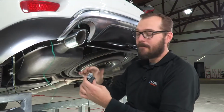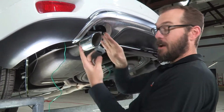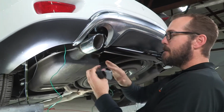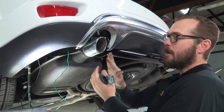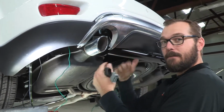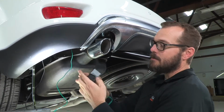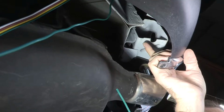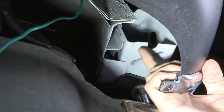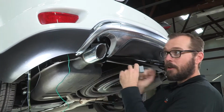Okay, back below our rear fascia here, we've got to get our passenger side connections from driver's side to passenger side behind the rear fascia here, and we want to be mindful of keeping this wiring away from hot exhaust, the spare tire, anything that's going to damage that wiring. And on this vehicle, the best option is to take this wiring through this square rear crossmember tube, and to do that, we're going to use a length of wire as a fish line to pull it through.